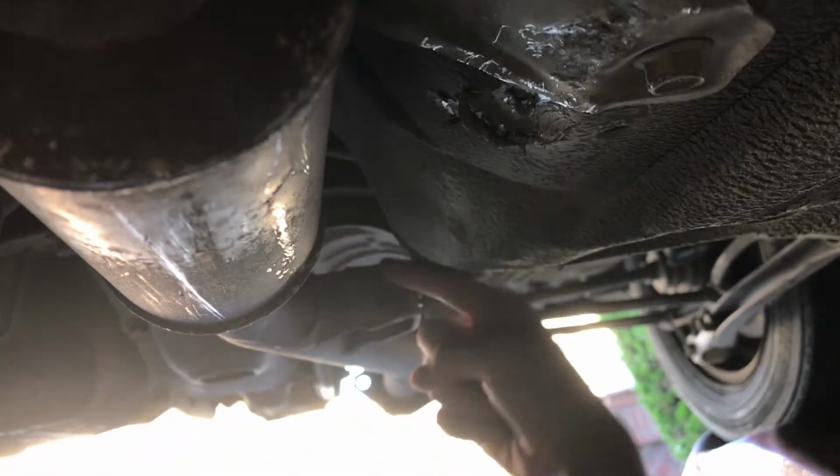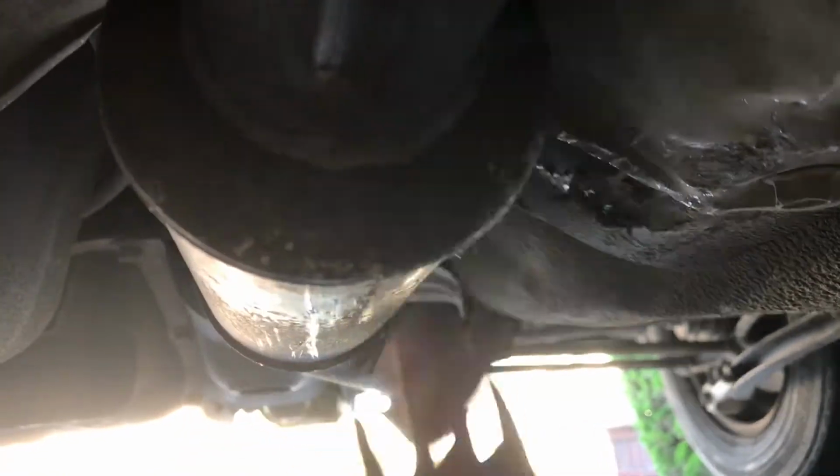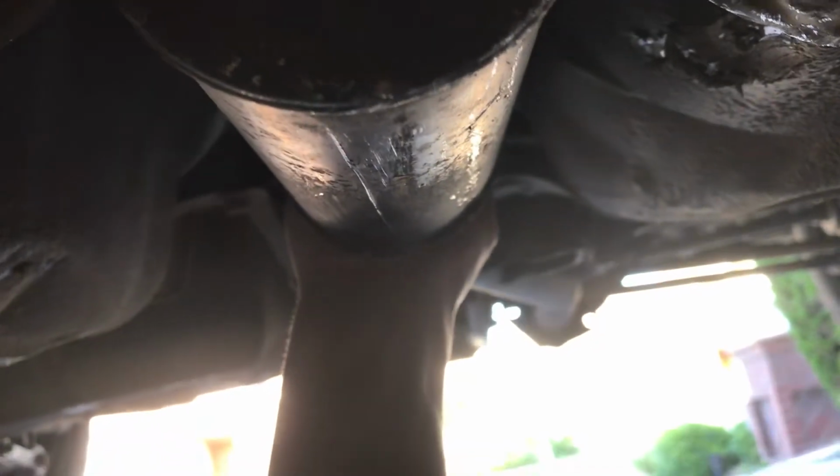I'm doing a check again because I just pushed it up. It seems a little close. So yeah, if you take a look from this angle, this should be flat. So if we turn it a little, imagine if this was turned a little, pushed upwards a little, I wonder if this would bind. So actually, it still doesn't, but the sheet metal is a little deformed, and it's pushing this deformed sheet metal into the drive shaft. So we're still gonna have to take a look at that, somehow form the sheet metal around it better.